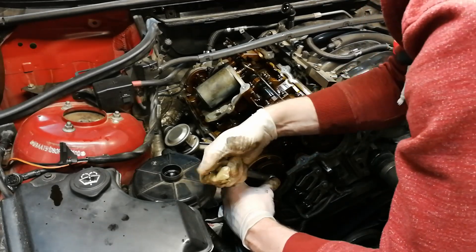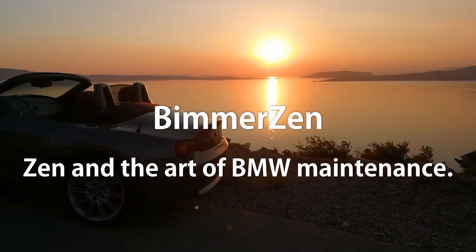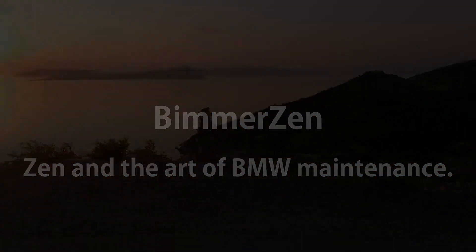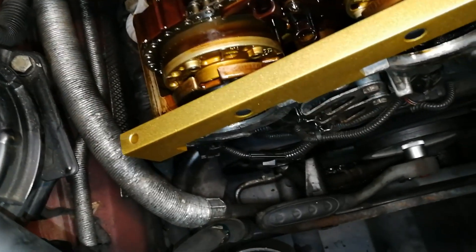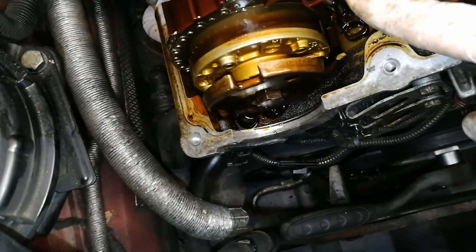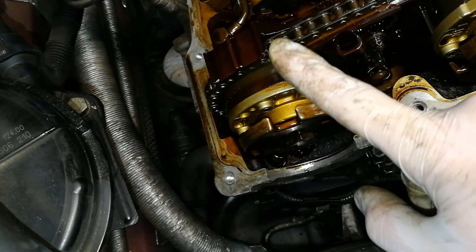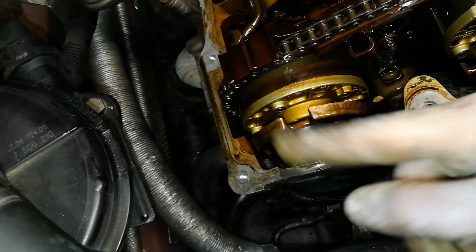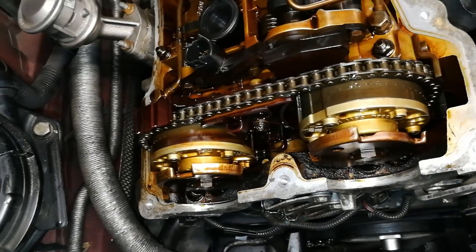This is not for the faint of heart. What I'm going to try and do is remove this tool and remove this bolt, and I'm going to manually try and jump the chain one tooth backward to see if that will put the camshaft back into alignment.